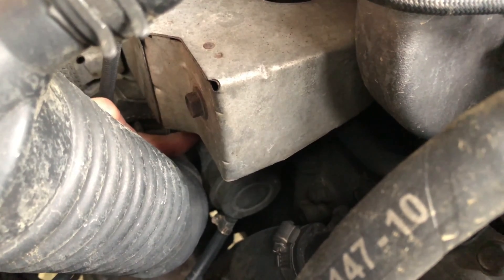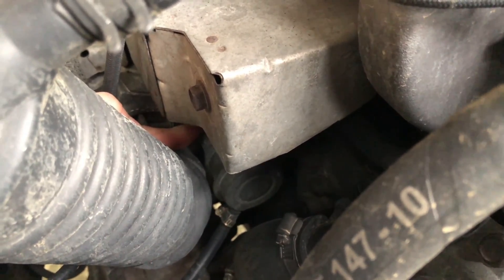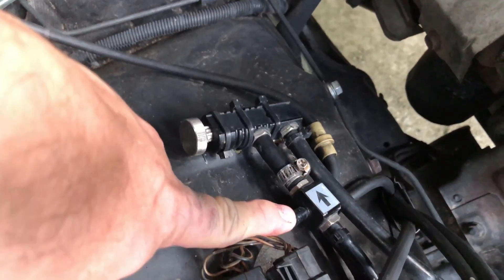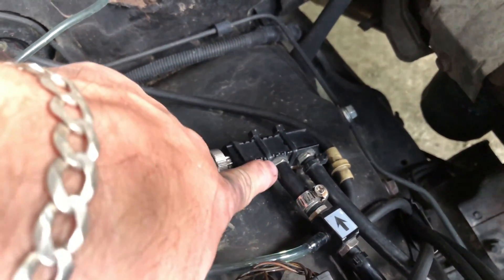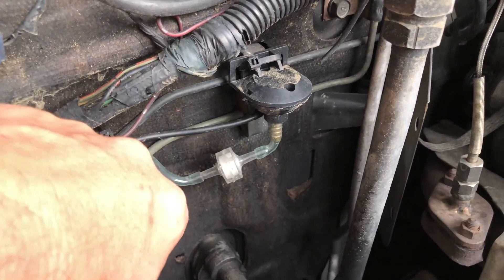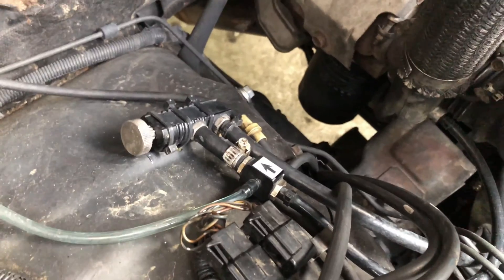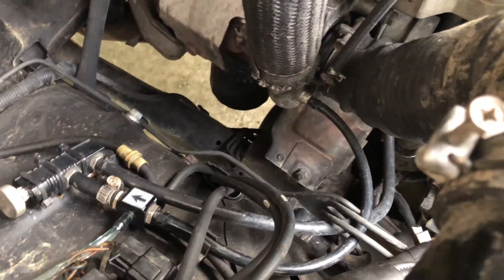...not dropping your copper washers. I've got three washers on either bolt, which gives about 3 millimeters of spacing, and so far that seems to do the trick. My boost sensor line t-splitter: boost comes from the turbo here and can go up to the boost control sensor, which is stashed right there. This is a filter to filter air going to it — it's probably pretty sensitive. If you have any more questions about how to install your boost controller, let me know. Thanks for watching.